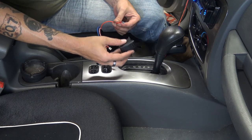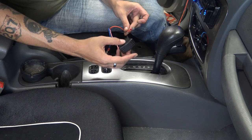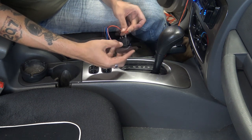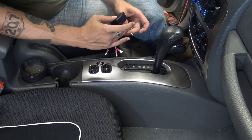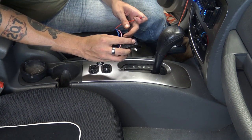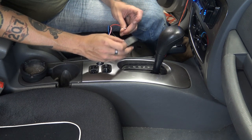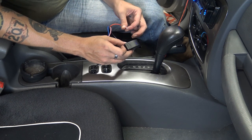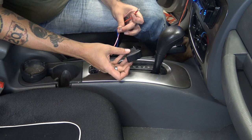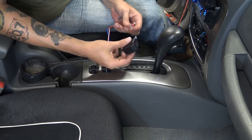We're going to hook up the switch, and you have a couple decisions to make. We have an orange wire from the battery, but you can also run this from a switched source like your fuse box that only comes on when the vehicle is on. The reason you'd want a switched source is the switch has little lights that come on — if you hook it directly to the battery like I'm doing, those lights will stay on all the time. If you have them hooked to a switched source they'll go off when the vehicle is off, or you can just not hook the ground to the switch and you won't have the indicator lights. So you have to make some decisions on how you want to do it.